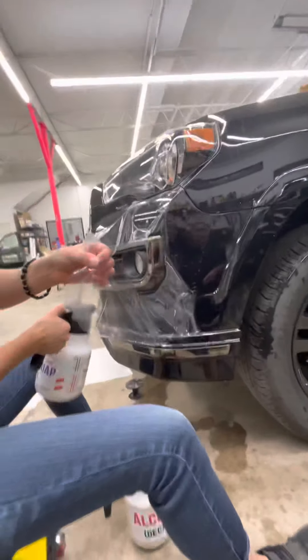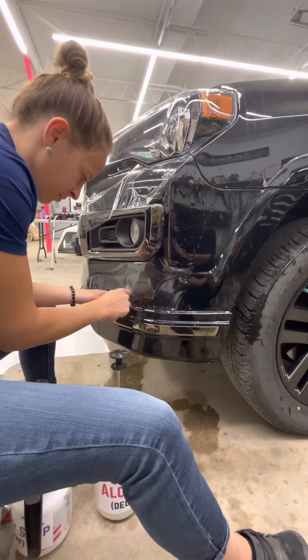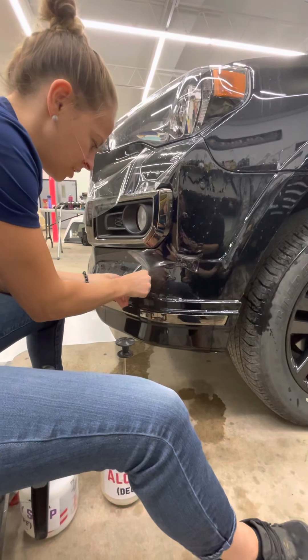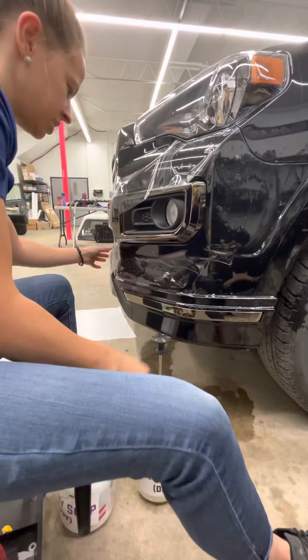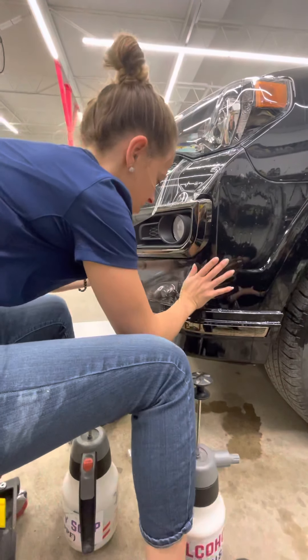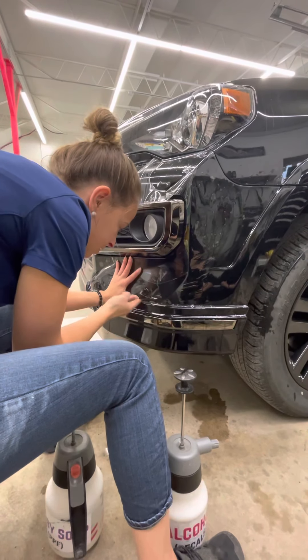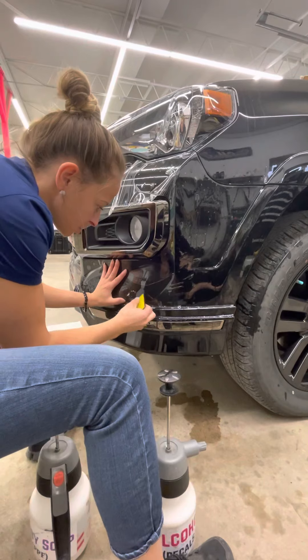I'm going to spray alcohol or soapy water under there again. The next thing I have to worry about is my sensor — I can see that I didn't weave this out. It's easier to pop it out when you're doing the vehicle just for the fact that it doesn't create another seam when you're unrolling it. So now we have to move this over to get that locked into place. I'm going to spray alcohol right on the sensor, making sure that this is slippery, and pull it and line it up. I still have to watch this line, this line, and the circle line — there are a few things to look at while you're pulling it. Make sure you're not pulling it crooked.